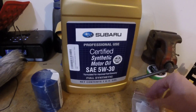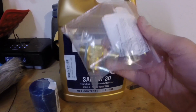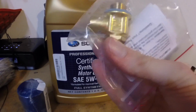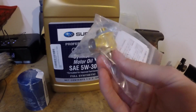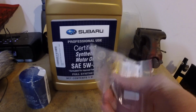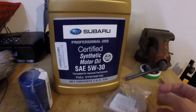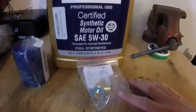Anyway, the other thing that's kind of interesting that we'll be adding is this guy. This is a Fumoto oil drain valve. I added this on my STI. Basically what this does, you put this in place of the drain plug. You've probably seen these on a lot of other channels and on my channel already. Put this in place of the drain plug, and then there's just a little lever on this side that you turn and it lets you drain all your oil out,